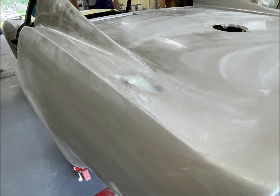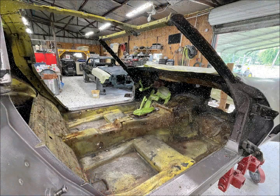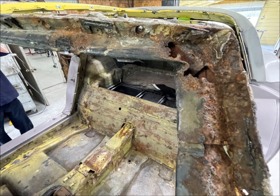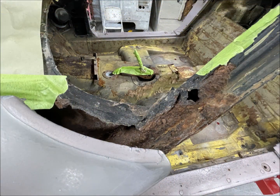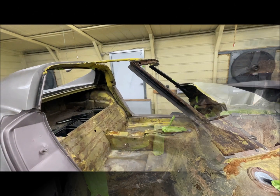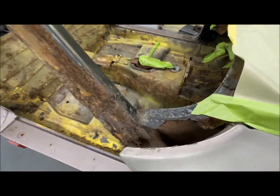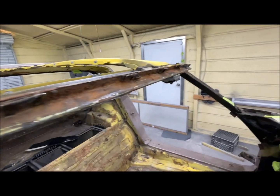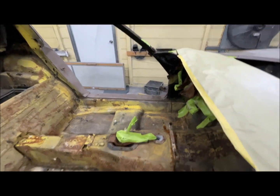The antenna hole was filled, by the way. And you need to look at something that was totally overlooked — something that seasoned Corvette builders know about. The bird's cage can easily be damaged, and some of this you may not see. So you have to be very careful to inspect a C3 closely, especially for T-tops and convertibles, and look in the wells where the body bolts onto the frame. I will show you more of this later in this video when it gets repaired.